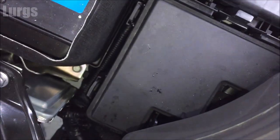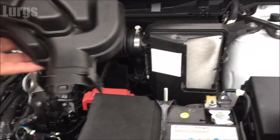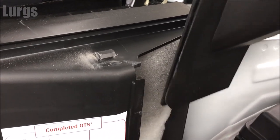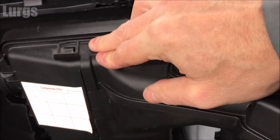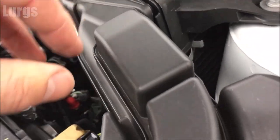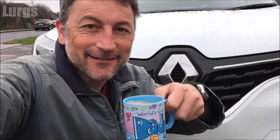Now let's put everything back — speeding this up. The slightly tricky part is the final air intake hose. On the left hand side at the back there are grooves — a sliding groove on the side and a groove at the bottom. You're sliding onto that groove and pushing it downwards, making sure it hits the groove at the bottom and tucks in tightly. Get it lined up and push down until it clicks into place, then the two clips on the hose further back should automatically clip in. Good luck with any fuses you have to remove or replace.